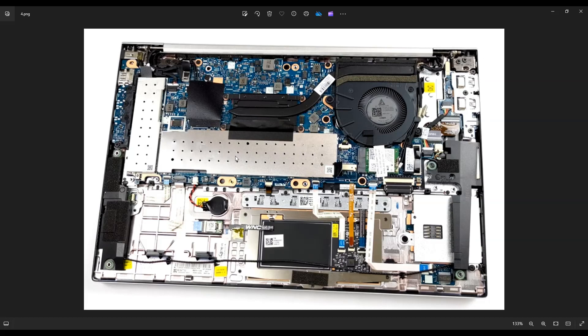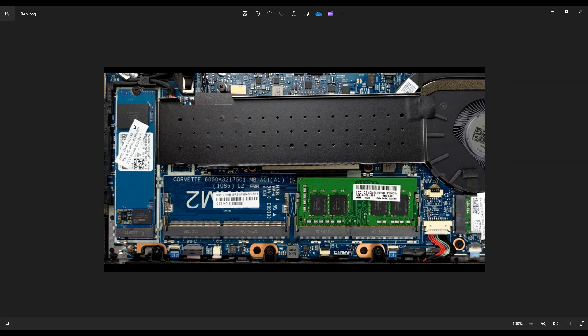The first thing I'll shout out is your RAM right here and your solid state drive right here — so this is your memory and your storage. These are just metal guards over them; they're not screwed down, so you can just pry these up and wiggle them out. This one especially is stuck on with tape to your heat sink assembly, so instead of ripping it off completely, you can just fold it over back on top of your heat sink assembly to access your RAM. You have two RAM ports and one M.2 solid state drive port here. To get the RAM out, there's a spring-loaded metal arm on either side of each RAM stick. You gently pry those apart away from the RAM stick, the RAM stick releases, and in many cases it'll even pop up a little bit so you can easily slide it out.